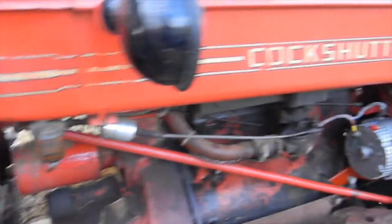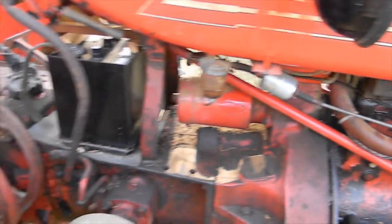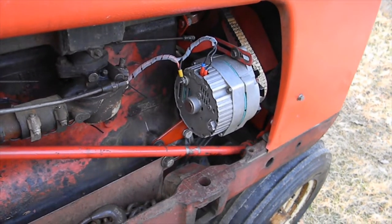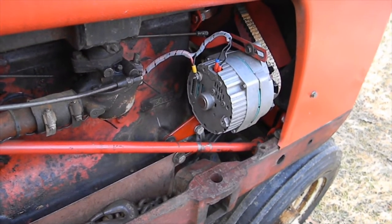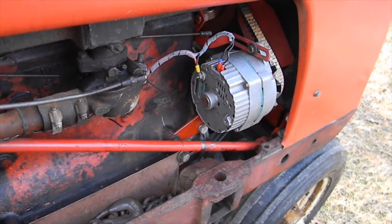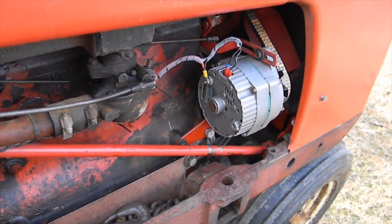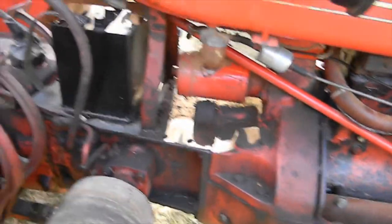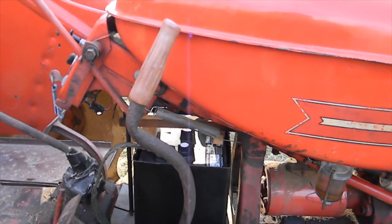I did try it with a charge indicator lamp, but I kept this six volts — you can see the battery in there. This was a 12-volt alternator, but I got a replacement six-volt regulator and put it inside. Now all it gets is six or seven volts to the field. Anything to drop that down, like a diode, you'd lose 0.7 volts barrier potential across the silicon diode — or maybe even more across a charge lamp indicator. I would have to rev the engine even higher to get it to start charging. I did try that initially with an indicator lamp and didn't like it.